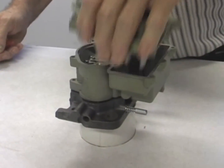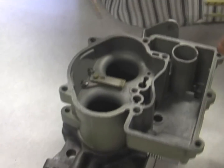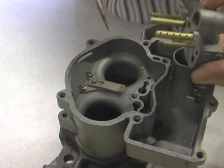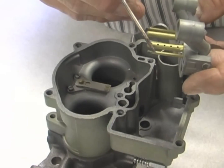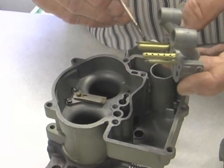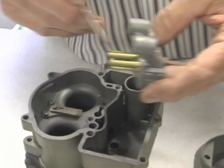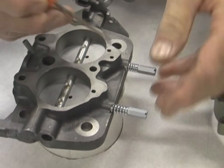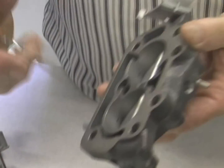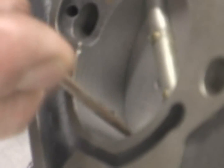Really the idle circuits start with the Venturi cluster, which a lot of people don't realize. Only the center carburetor has idle circuits, and fuel that's puddled in the float bowl is drawn up these small tubes on the end of the Venturi cluster. You notice that your end carburetors do not have these tubes. They're pulled up through here, eventually run through the carburetor through these two holes here, and then into the throttle body under the throttle plates.